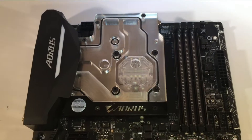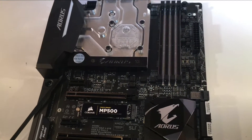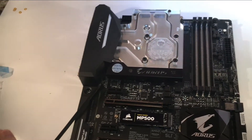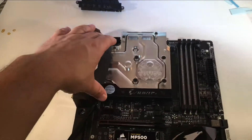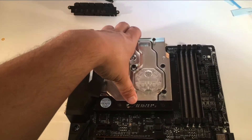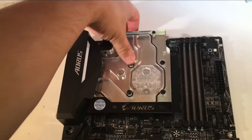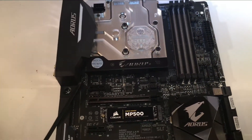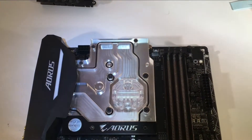But aside from that, very easy to do. This can be a little bit daunting to some people who are new to it. If you've installed computers into your systems previously, it's really no big deal. I would say the most challenging part is getting over that fear of putting it on, and then really just the portion where you have to hold this steady and flip the board over. Just make sure you hold it together, flip it over, put one of the screws in quick with the Allen wrench, then secure another one — and you're pretty much good to go. It'll mount very sturdily and won't budge.